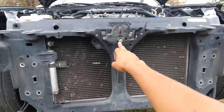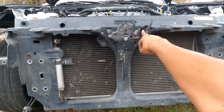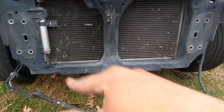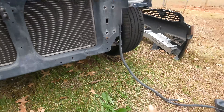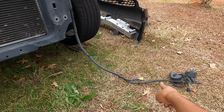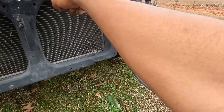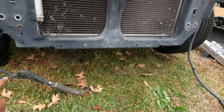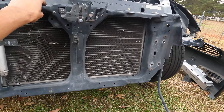Now that that's all out of the way, you can put all of your bolts back into everything we took off just to keep track of them so you don't lose anything. At this point I've taken the horns off, taken the hood latch cord, fed it back through, took it out up there, and detached it. Now we're just about ready to get this piece off, but first you have to drain the coolant from the radiator.